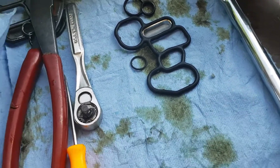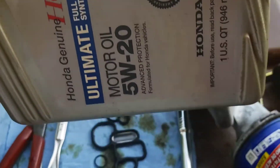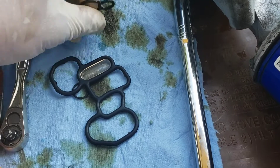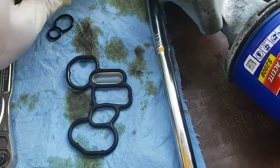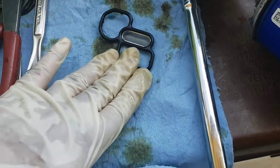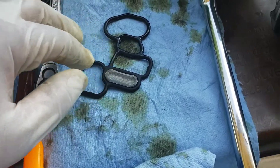For this process, some people like to do it different ways. I like to lay them all out and just dribble a little bit of oil on the seal so it's not a dry surface mating. Get a little bit of oil and kind of rub it on the seal — that way you have some lubrication and it's not rubbing on any aluminum, because you can actually break it apart if it's not lubricated or if it catches.